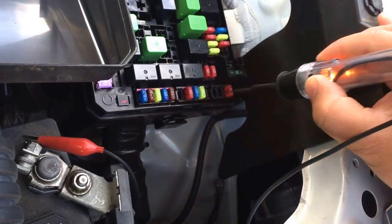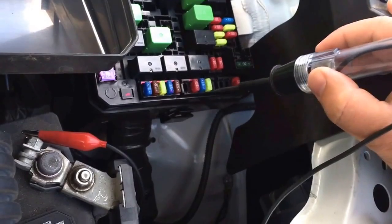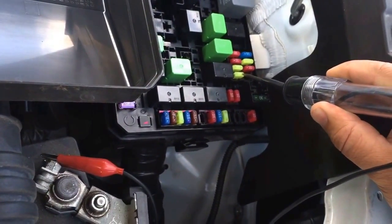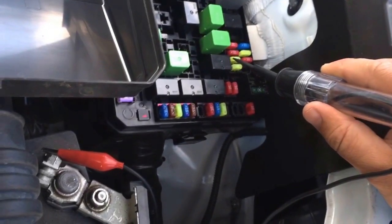So this is how you check the fuse — it's pretty simple. One end has power and the other one doesn't — it's a bad fuse. And if it doesn't have power on both ends, don't replace the fuse, because that circuit probably is not getting juice. It will get juice when you turn on, let's say, headlights or whatever. In this case, this is a headlight fuse.